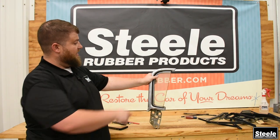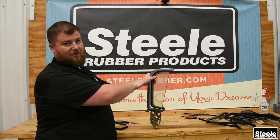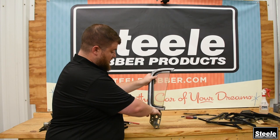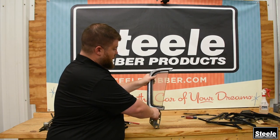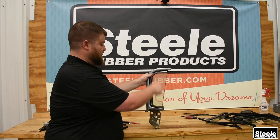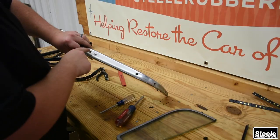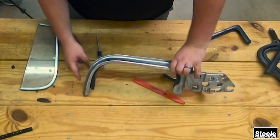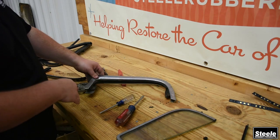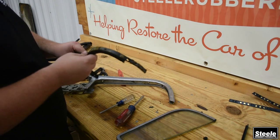One of the biggest differences is that the upper pivot point is not exposed on the outside or the back. So once you take this one out of the door, the spring actually holds this one up. You remove the spring, it drops down, and the other pivot just comes straight out, and then you can remove it. This one was held in with a few screws on the back side, so we remove those. There's actually metal inside the rubber, and this comes out just like that.